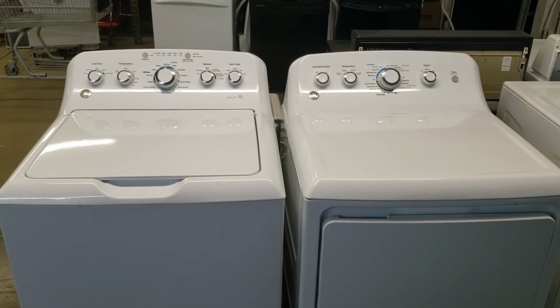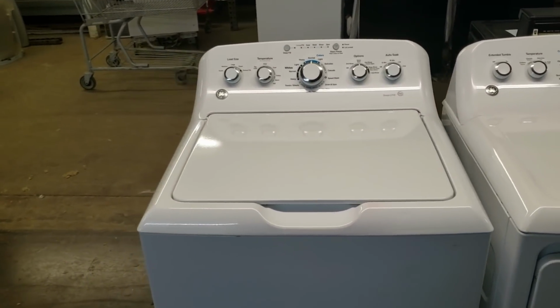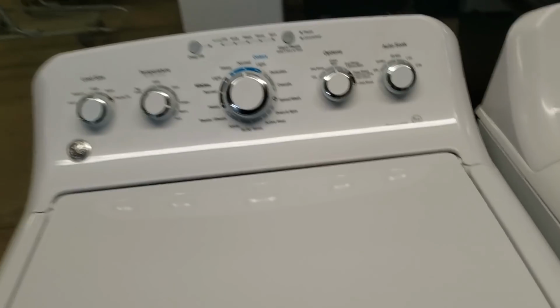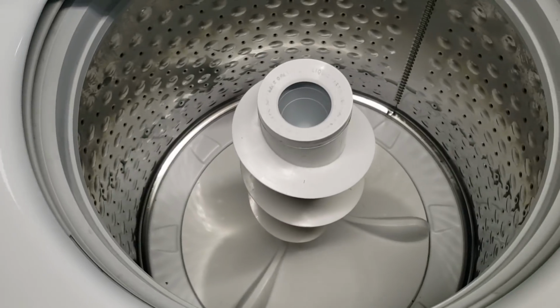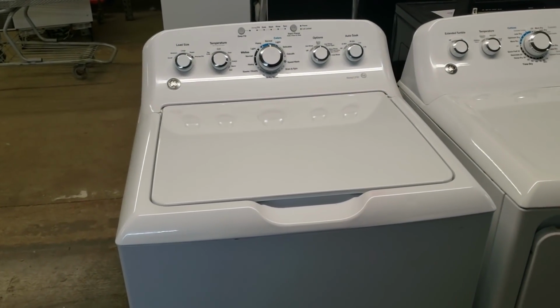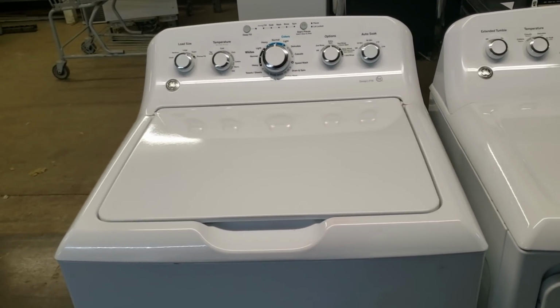So here is the washer dryer set fully done. Everything went okay with the second and third cycle of the washing machine to make sure that everything was going to work fine. It tested out good despite giving me a giant scare. Turns out if the comforter is about the only thing in the unit, it can tend to move around the floor quite a bit. Did not have to replace the suspension rods, cut my arm up kind of good, testing them, getting them out, and then checking the resistance on them.